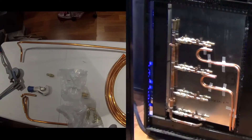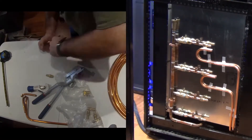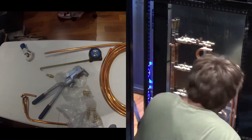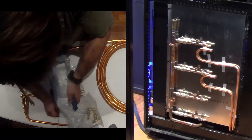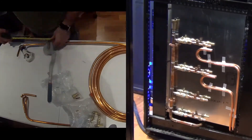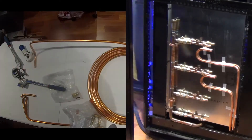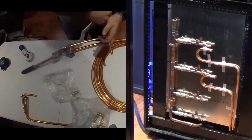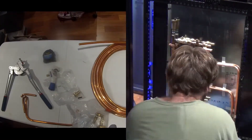Along with the return manifold, I have hard copper lines that go from the supply manifold to the inputs on the return manifold. I did this so that the tubing from the computer all leads to the same place. I made them out of copper because it is less likely to kink and won't turn into a complete mess. The supply lines have to be twisted around the rack, which makes them a bit difficult to make. Basically, what I am doing is eyeing up where the copper has to go, then bending it and hoping it fits. Please note the scotch tape holding the copper in place.